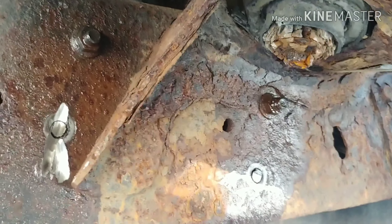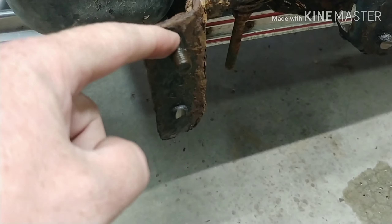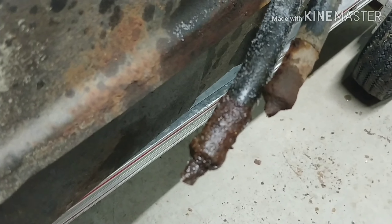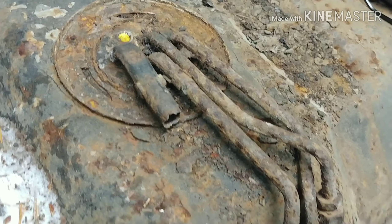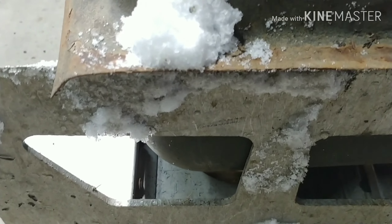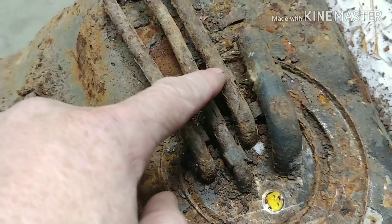The tank is out. I was able to take that bolt out — it's actually a stud, so it could be pounded back in. The other one I ground off. Up here in the Northeast we've got rust, so the lines up in the frame rail were bad — I had to cut them off there. I'm trying to figure out where to stop the hemorrhaging on this job, because obviously new fuel tank, new sending unit, new fuel pump, and new fuel lines would all be great.